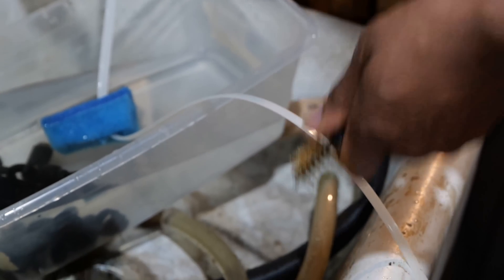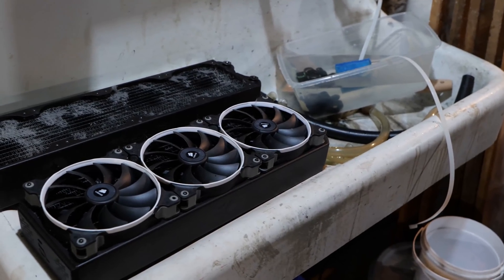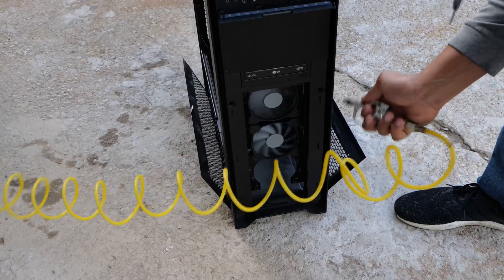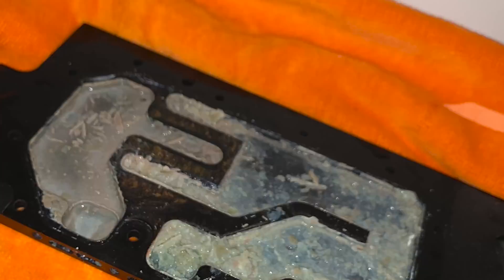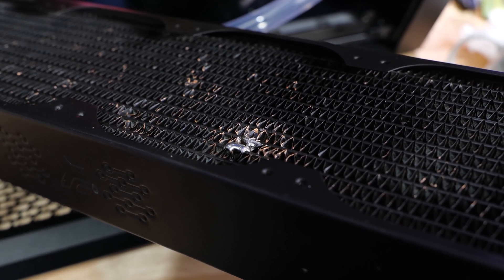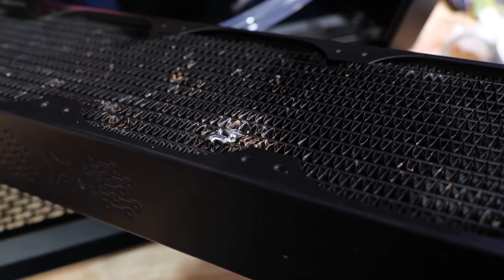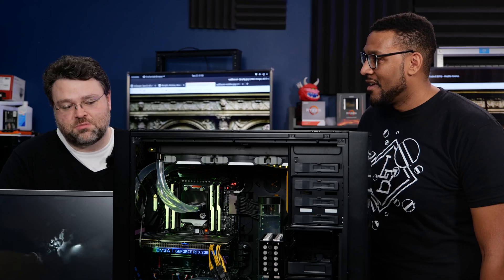Who did that? It's a terrible thing. It was given as a gift — terrible, but in the best way. We spent a long time cleaning it, using some vinegar. The blocks are full of junk and a couple of the video cards literally died — one has bad VRAM because of the heat, two won't post, and the other is clocking really weird. Four GPUs dead. We tried to reuse some fittings — that was perhaps a mistake. It started leaking. That radiator sprung a leak, required a little bit of soldering. It was the quick release fittings. They were suspect. I said they were suspect from the beginning, but we used them anyway. That was a mistake.